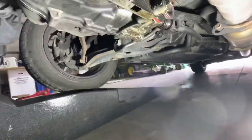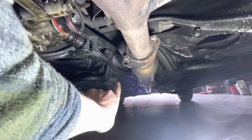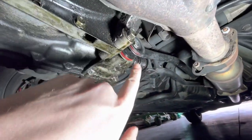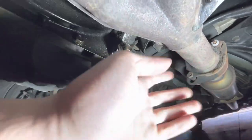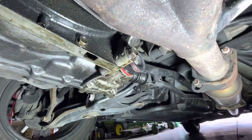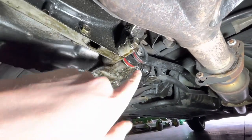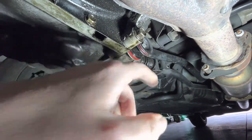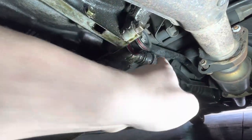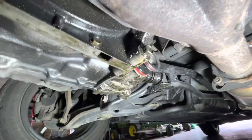After reviewing the video, I forgot to mention: when you're pulling out the rod, once you disconnect everything down there with the 10s and the 12s, you do need to take out this 12 millimeter to basically take this whole rod out. So just start putting in your polyurethane bushings and the short shifter. Just undo this bolt and you can take this whole rod out.